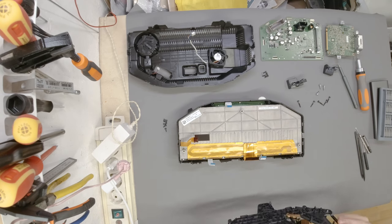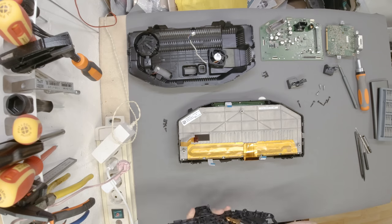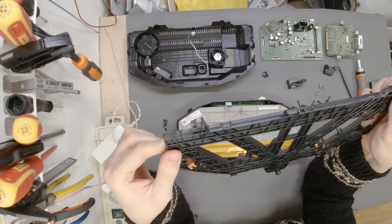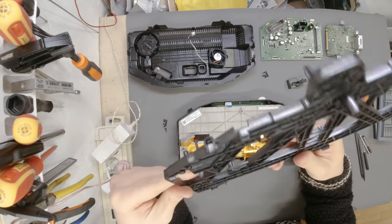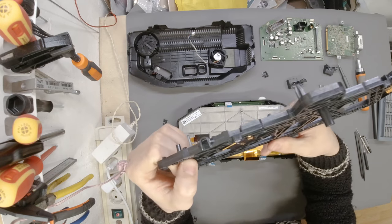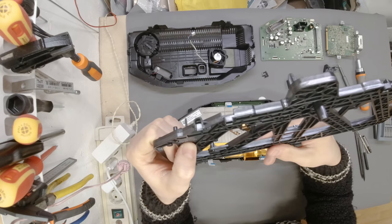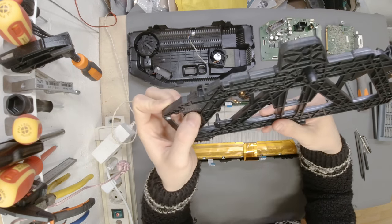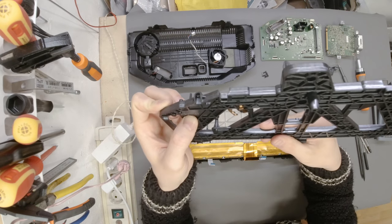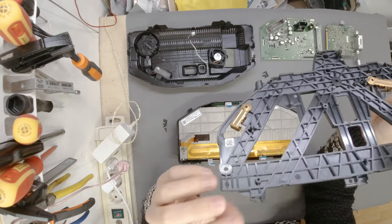because we need those two things glued together first. It sounds like aluminium. It really does. It feels like aluminium. Looks like aluminium. But it's some sort of fiber composite. There must be a marking somewhere. Marking just on this side. Let me see. PPSGF. So most probably something plastic. Graphite fiber or carbon fiber or whatever. Glass fiber. Yes, my goodness, the graphite fiber. So this is a glass fiber reinforced plastic. This is why it looks and feels this way. And you can almost tell that it is aluminium.